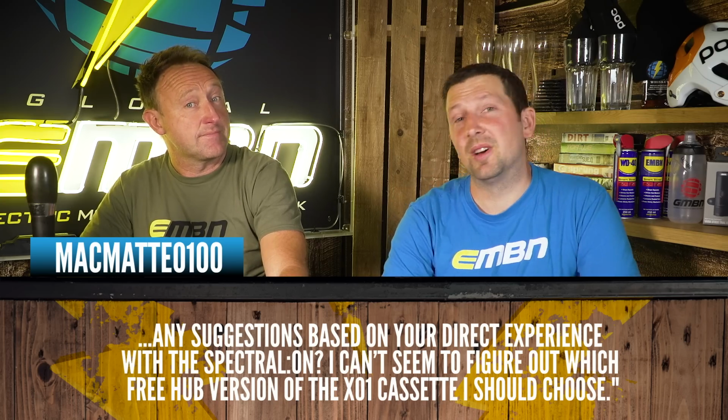Well, from my personal experience with EX1, I don't know if I speak for you, Steve, but it is quite a talked about subject, really. It's an 8-speed cassette, but there is quite a big jump between 3rd and 4th. So you find yourself on a hill and you'll either be spinning out crazy or you click it down a gear. There's quite a big jump. I can't remember the actual ratio. So quite a lot of people do swap them out for a bigger 11 or 12-speed cassette. Like an NX Eagle 12-speed? Yeah, exactly. The actual EX1 is a standard Shimano splined freehub, so any cassette that fits on that would be a good choice. But bearing in mind you're going to be going from an 8-speed system to an 11 or 12-speed, so you're going to have to change the shifter and the mech included in all of that.